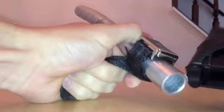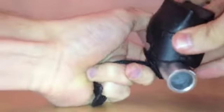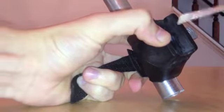Next, place the plastic bracket over top while still holding the nylon belt taut. You may want a second person to help during this step. Once attached, screw in the screw at the top of the bracket.